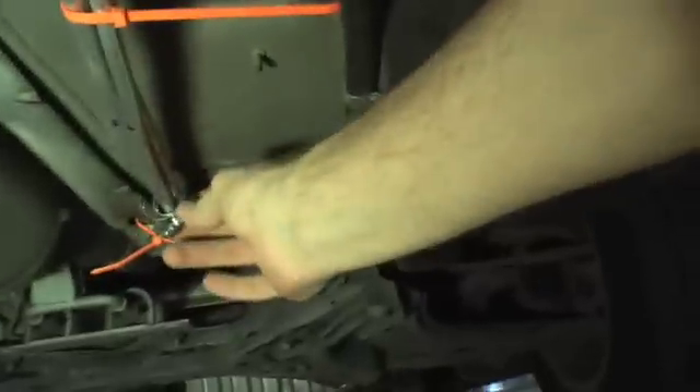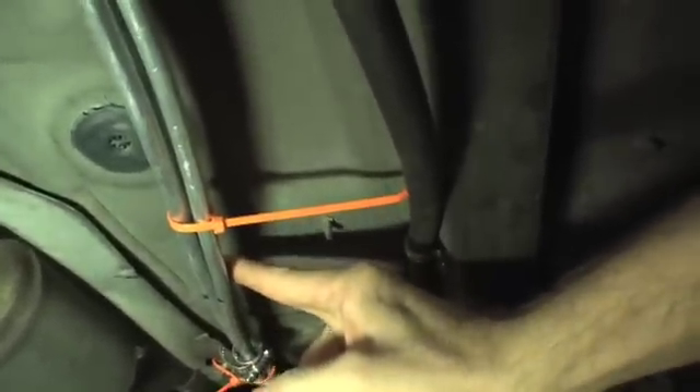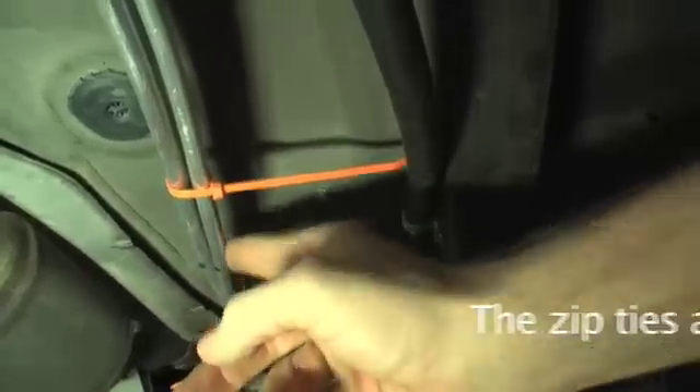So I pulled out the aluminum lines — here they are. I've put them together as best I could: two coolant lines — one going down to the Vormax, one returning — and then a veggie line to the engine after the Vormax. They've been bundled together. I'm going to go ahead and insulate them; I just wanted to test drive them first to make sure nothing was leaking. It runs along here, along aluminum, and then at different points it transitions to rubber.